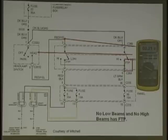Blown fuse, very good. You didn't know that, write it down. What's happening is you've got one ground, make believe this is one ground. If I've got two separate fuses like this coming in, I could basically backfeed off that separate ground going back. They share the same circuit of ground, and that's why you get one bright light and one dim light. So make sure you check things like fuses and you know where to find the fuses.